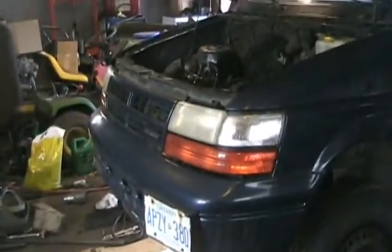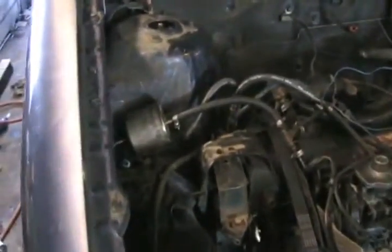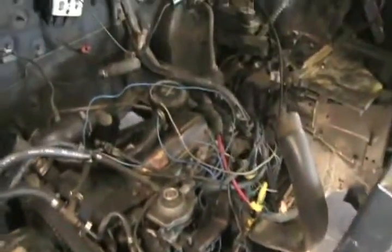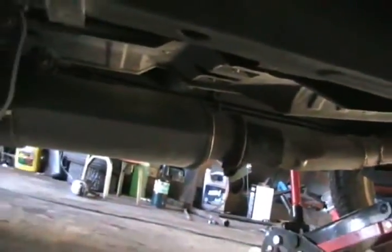More of day two. Got the motor in now — it was just straightforward, like dropping a V6 back in. That diesel was all modified to fit one of these vans. There's lots of space; easy to work on. Got to do all the plumbing and wiring now, put on the air cleaner box, hook up the shifter cables, got one axle in, put the battery in, slip the other axle in. Then weld up the exhaust pipe where I've attached the diesel pipe to the original muffler from this van.